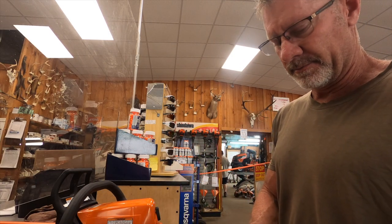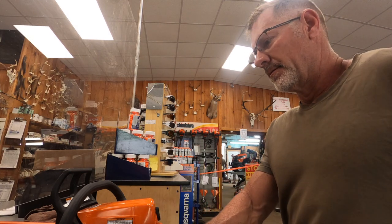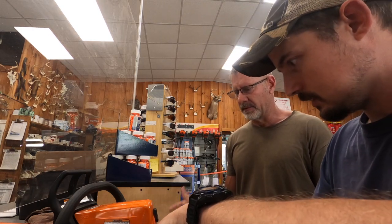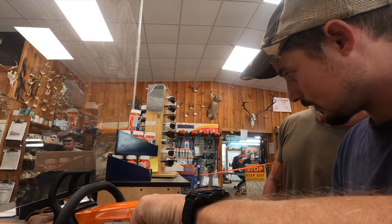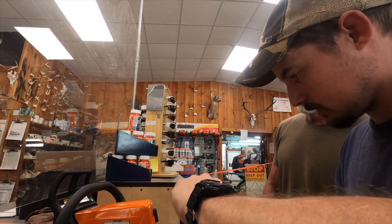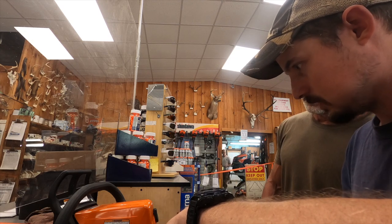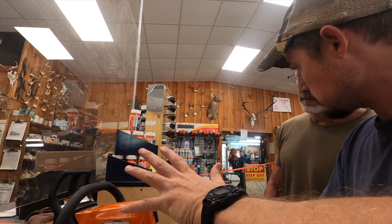How are you doing today? Doing all right. You got me for the oil? I got you for the oil. As far as starting on this thing when it's cold: squeeze your trigger, rotate, push it all the way down — full choke. You got to squeeze the trigger or it won't go all the way down. Usually about three or four pulls at a hit, real subtle. No more than four pulls on full choke. Then clip it up one position — half choke. Next time you pull it, it'll fire up like a fast idle. Put your throttle and it goes to idle.